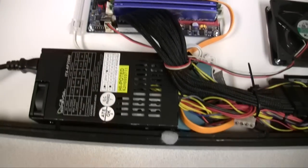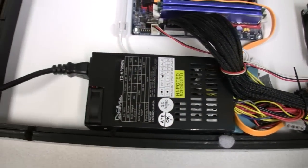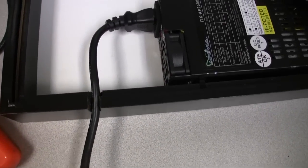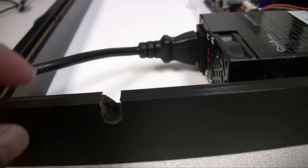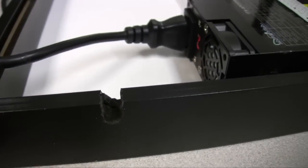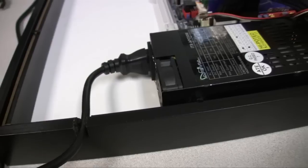There's the other light and wireless cards. Here's the power supply, which is held down by Velcro. I made sure the ventilation is facing up so all the heat can come out. And this is the hole I made for the cable so that it hangs straight down — I drilled the hole, made a cut straight down, took out that little chunk, and painted it black. This slot will fit the power cable and one more cable, like an Ethernet cable.